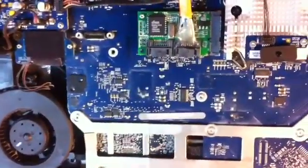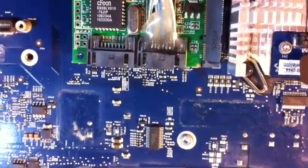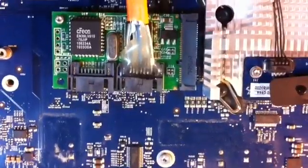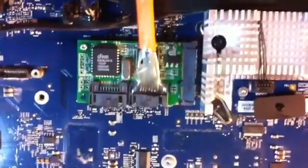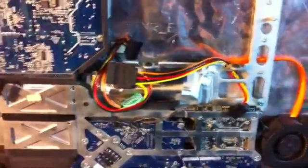The big challenge was to modify a SATA cable. I cut off the end of one SATA cable — this orange cable here — and had to take the little wires and solder them to the little pins. Those pins on the right, I soldered each wire to them. That's probably the hardest part of this whole mod. Now I've got a custom SATA cable running.